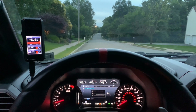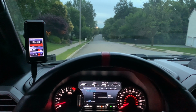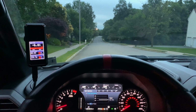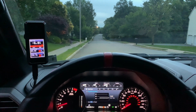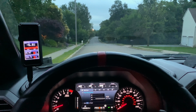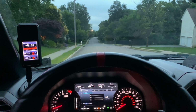But now going over, at least on roads, I have yet to test it off-road, so I will and get back to you all on that. But that'll be after I complete all the suspension mods, including the upper control arms. It's a lot smoother, even on super bumpy areas, just completely broken road. My rear end is not kicking up anymore. I keep traction a lot better. It stays a lot smoother, and there's just less noise in the back too. It's really interesting. I wasn't expecting this.